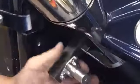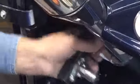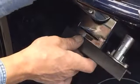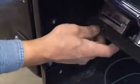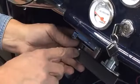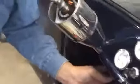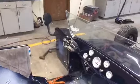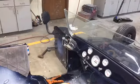Now this hole that I've got centered up under here, if you got an angle drill or something, we have an angle drill that works well. I don't know if you can get a full-size drill in there. But I'll come from the back side. Once this is all straight, I'll drill coming out the front. And I'll put a button head bolt on here, quarter-inch stainless steel, about 1 inch, polish it, make it nice. Something like this, right here.